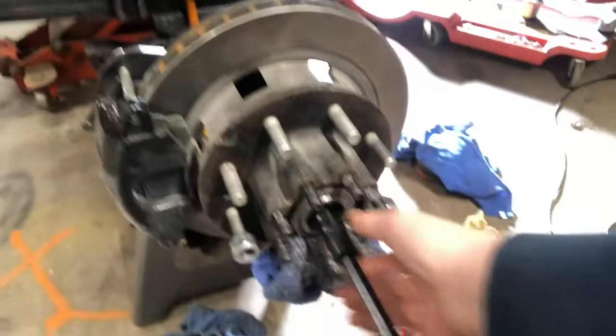Last night, I spent about 2 hours on drilling this thing, and this is not for the impatient. This takes a long time. I probably total only about an hour of actual drill time, and every minute or so, I pull it out, clear the chips, relubricate the blade, all that stuff. I would touch it, make sure it's not getting too hot, and actually, it was pretty cool to touch for the most part. So as you can see, this is about how deep I got.